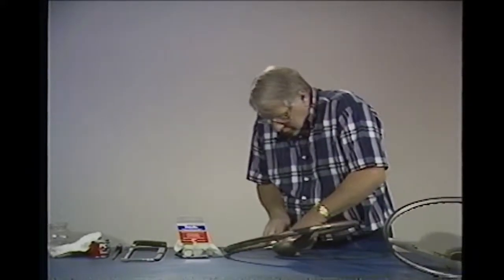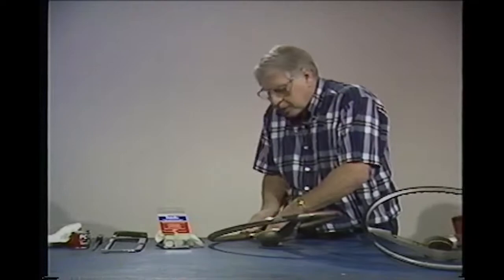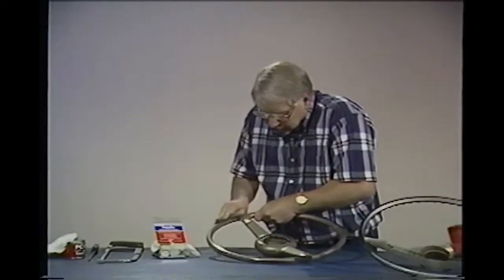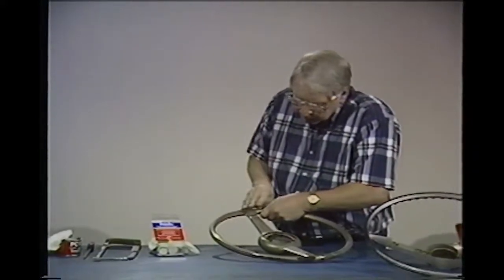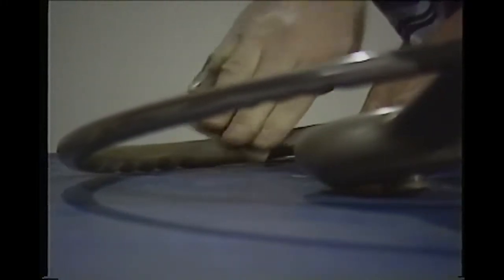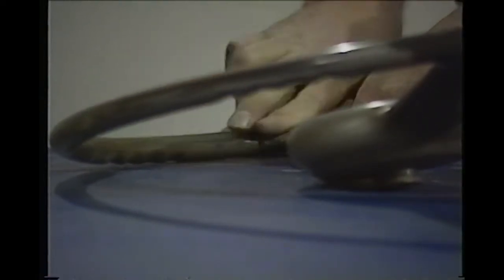You can make beautiful wheels like this. We've had wheels that have had maybe an inch or 2 inches missing in it, and we just built it up with this material. You got to get it all the way down. You can see here this has got paint and primer on it, and there's the black plastic. This paint they put on there is a good hard paint. And we're going to do the same thing when we get finished with it.